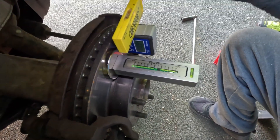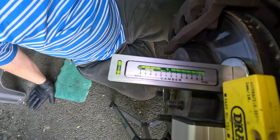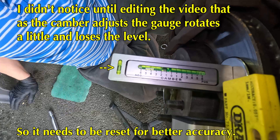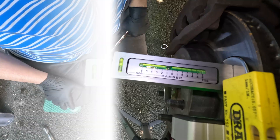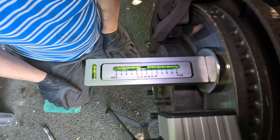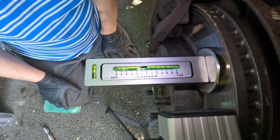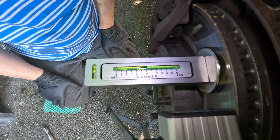You're never going to get it exactly right with this method — probably the only way to get it really accurate is by laser wheel alignment at a garage. The adjustment is quite stiff but I'm just going to do it a little bit at a time to see whether I can get the bubble to move. Once adjusted, the trick is to tighten it back up again without it moving. We do it up as tight as we can without disturbing it, then torque the bolt — and that should be the camber adjustment done on this side.